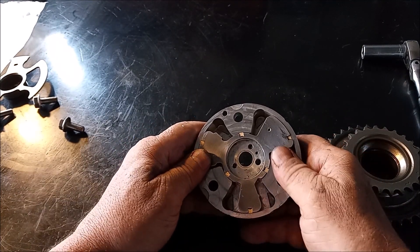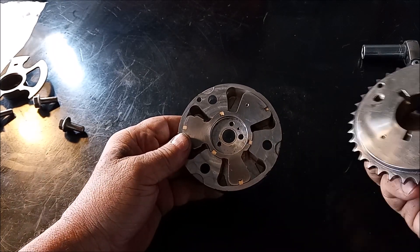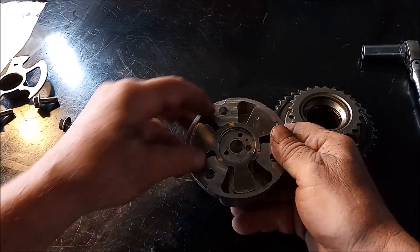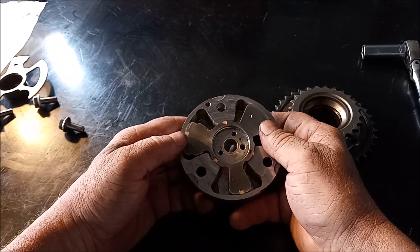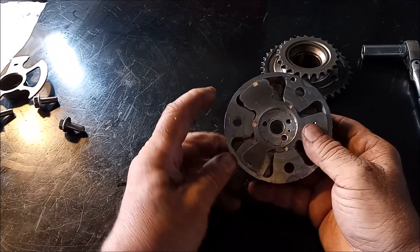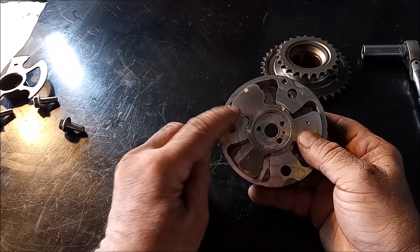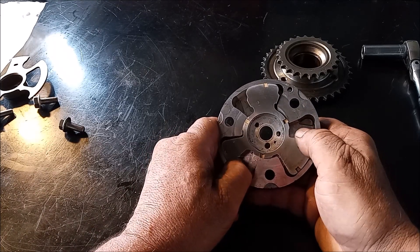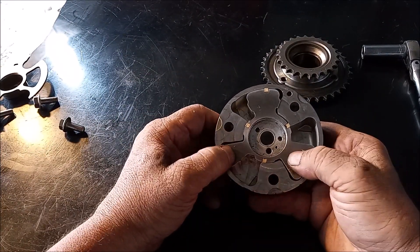It's pretty clear that you have three lobes. I've already unlocked this — when you look from this side there is no visible locking pin; the locking pin is down on the other side. You can see it moves back and forth. This right here is the mechanical stop — this gives the maximum advance. Moving forward again we go to the rest position where the pin will engage, and you can hear it click and engage into place.